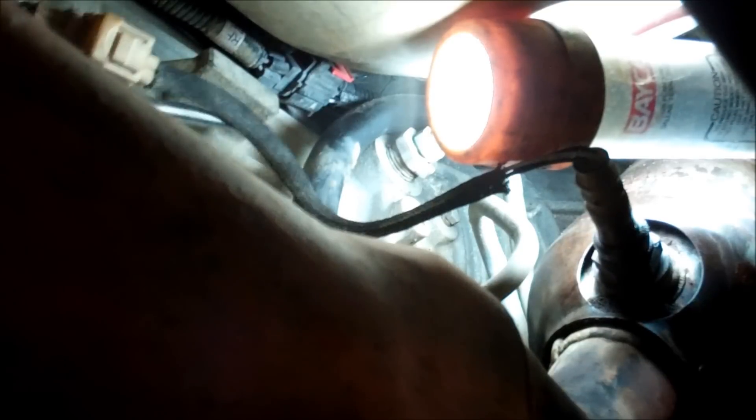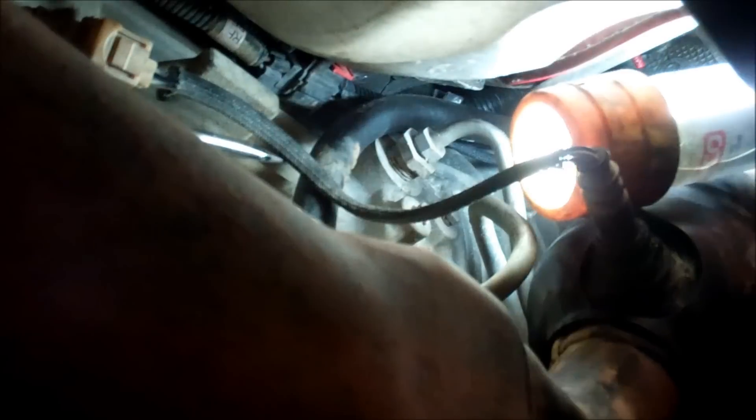What I'm doing here is I'm releasing the red tab from the oxygen sensor connection plug. The actual plug for the bank 2 sensor 1 takes the majority of your time. I spent a good 20 to 25 minutes undoing this plug. As you can see, it definitely takes a long reach tool. I had a flat head screwdriver that I could use, and then once I got it released, it was just a matter of positioning myself in the right spot to get my hands on it and disconnect the plug.